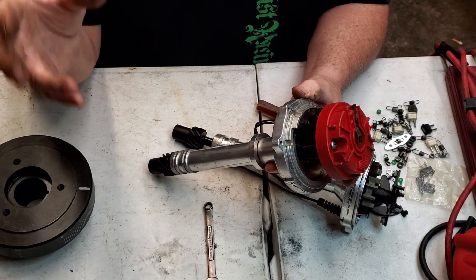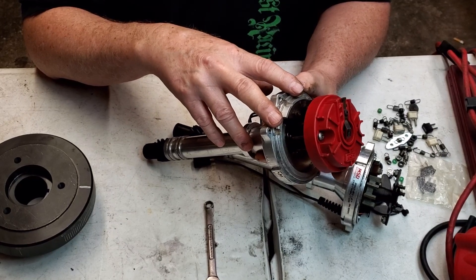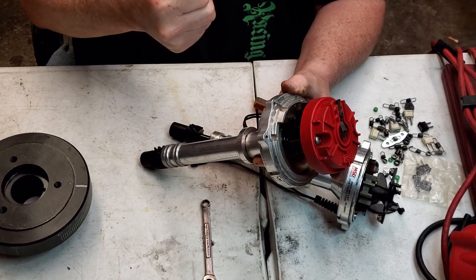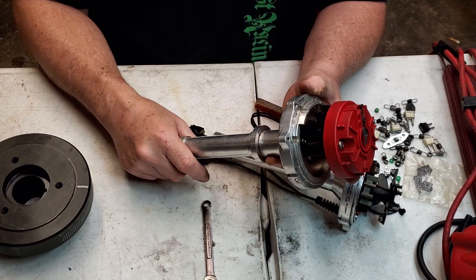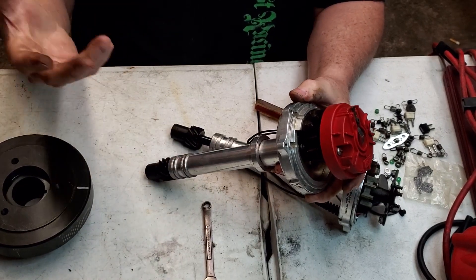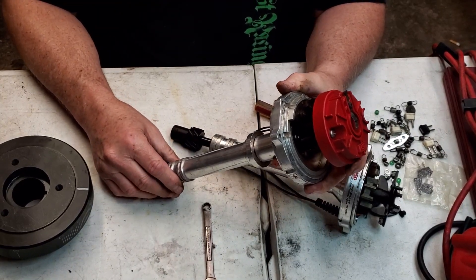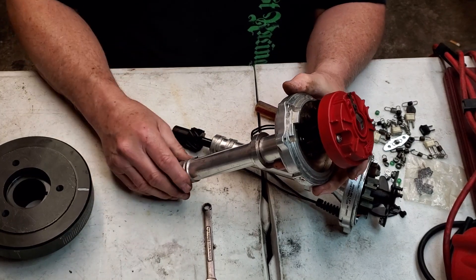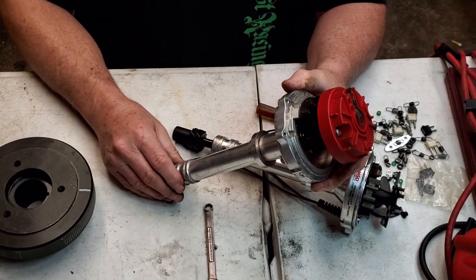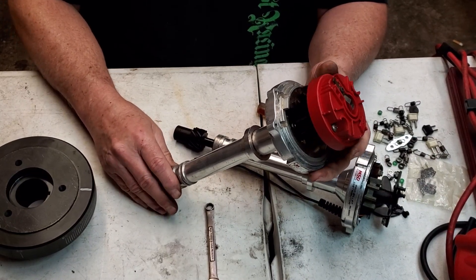You're not going to get all that crazy movement with the timing, and it actually helps a lot unless you've got a lot of slop in your actual cam in play. This is going to read pretty close — if your teeth match up perfectly and they're not loose, it's going to take almost all the slop out of it and keep the timing more correct. Make sure you keep your idle up on these things when you're running this much timing. Do not load the motor — it's firing 36, 32, 38 degrees before top dead center, so it's trying to stop the piston.